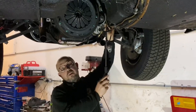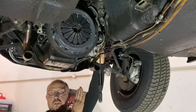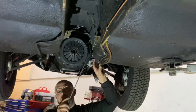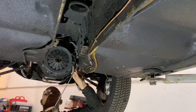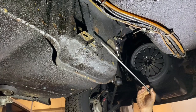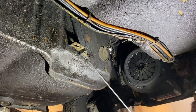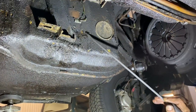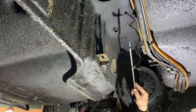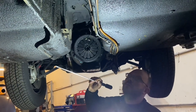What makes it a lot easier is if you have a long bar and you just gently lever between the exhaust manifold and the chassis rail just to push the engine over slightly - you'll find the box will come out much much easier. Whilst we don't actually need to do anything to the tunnel in this area to fit the five-speed, if our car was manual then we do need to make some modifications. To fit the five-speed we need to trim away some of the stiffener and some of the original gearbox mount because the five-speed is particularly bulky in this area. We can trim a bit away and we will also need to widen the tunnel slightly. We use a hydraulic jack to spread the tunnel slightly, and a little bit more of a dent there, and that is all you need to do to the tunnel to make the box fit.